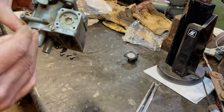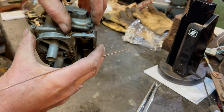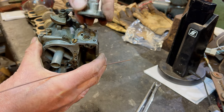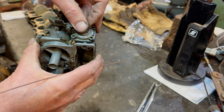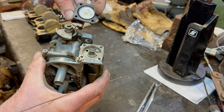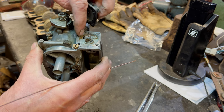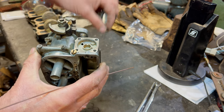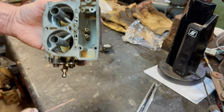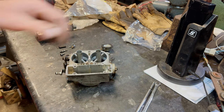And then when you push the pump in, when you force the pump down, which is obviously on that return spring as well, see that's on there, when that pumps, that will force it down there, and it won't want to go back through that little hole because it's smaller, so it'll choose the path of least resistance. Well, obviously the jets are quite small on the other end, but it'll have some oomph behind it then. Anyway, that's it, I reckon. So I'll put that blanking plug in and that should sort it out.